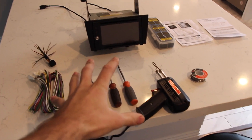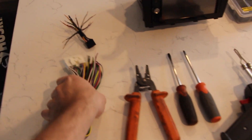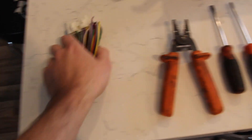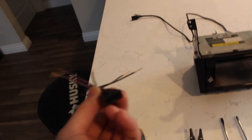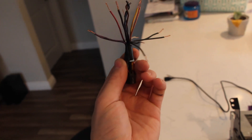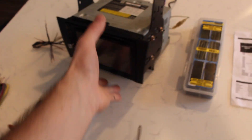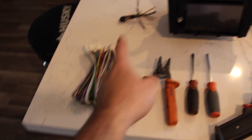I pretty much put everything together that you're going to need to do this. I was just going to bypass my amp by cutting and soldering, but I found on Amazon somebody actually makes an amp bypass kit which comes with everything. We have this, and then this is a used stereo — it's a JVC, pretty much a basic connector. I think it's like a 16-pin and I already separated all the wires. The ones going out to the side are all the left, right, front, and rear speakers, and the ones in the middle are the powers, grounds, and illumination. I got this DIN kit from Amazon — it was $13. I'll put everything in the description.